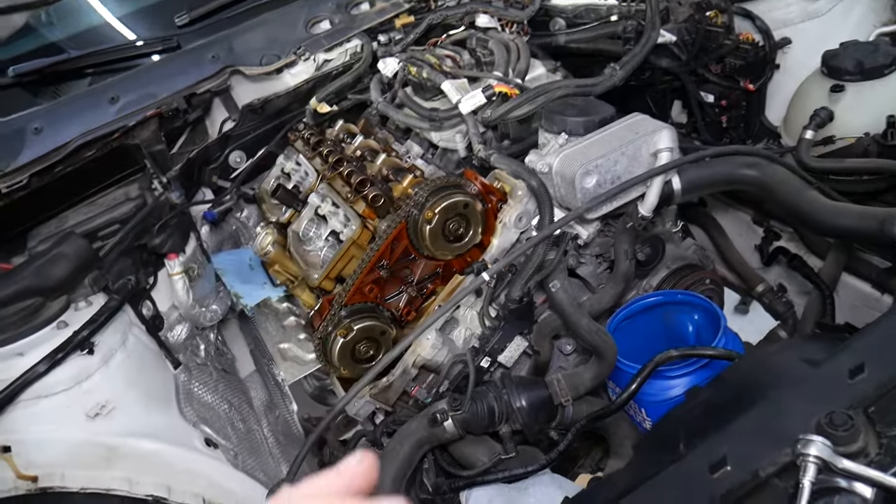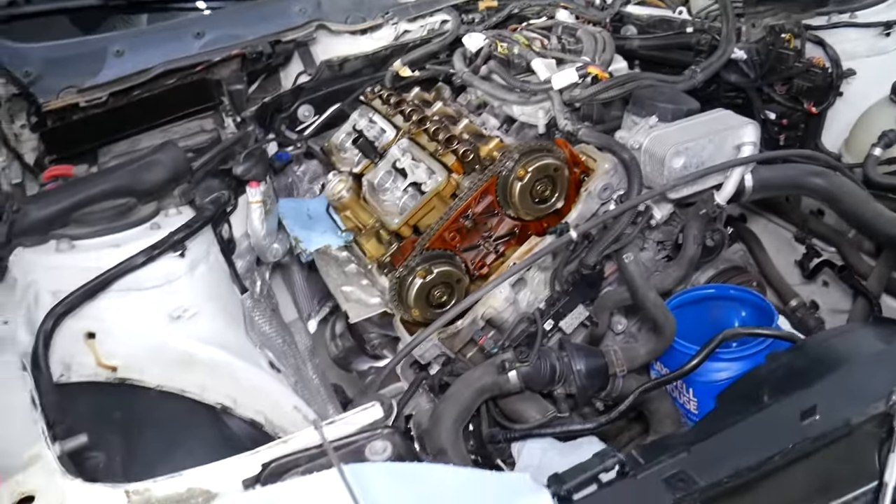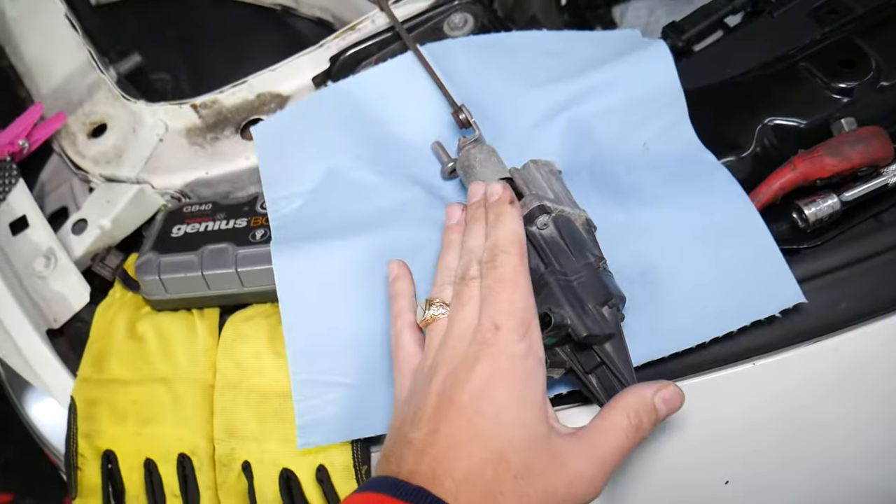The reason you have that is — let's say your engine hypothetically works at about 20 PSI. When the turbo reaches that 20 PSI, the wastegate actuator will start opening slightly so it can compensate and make sure the boost stays at a certain level, so you don't over-boost your engine. If you over-boost your engine that could be catastrophic and you can completely destroy it.